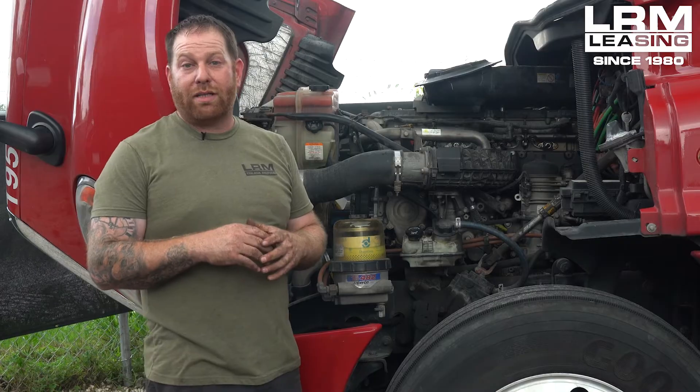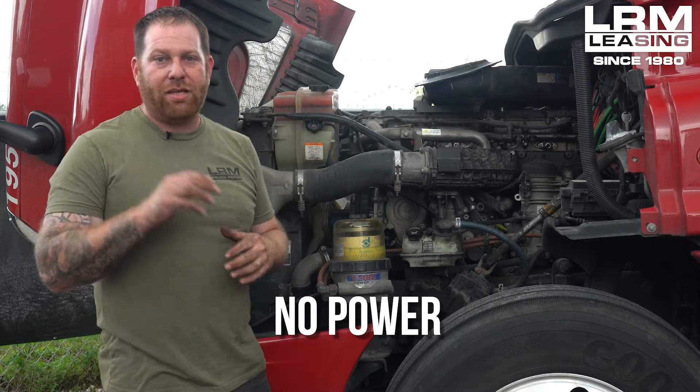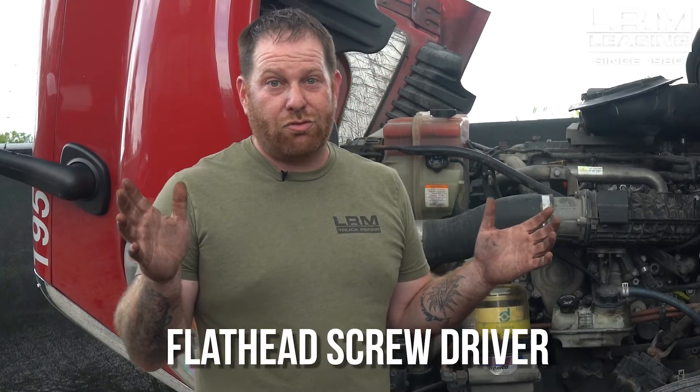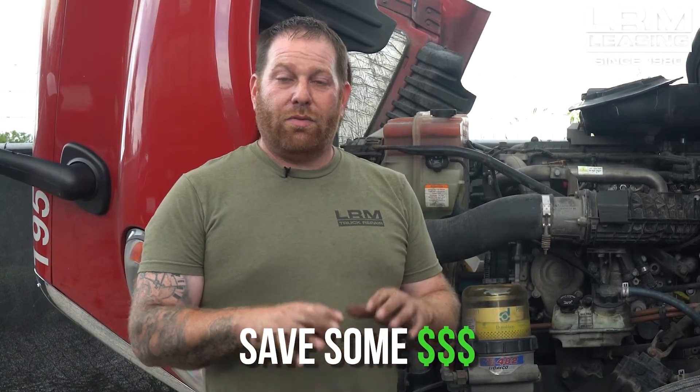If air can't go through it, your turbo's not getting air and you're not getting that power that you need when you climb a hill or sometimes even on a straightaway. That's where I would look — something as simple as replacing an air filter. I threw a video not long ago about an air filter and how to do it yourself to save you guys money. You would only need a flathead screwdriver and just a little bit of your time.